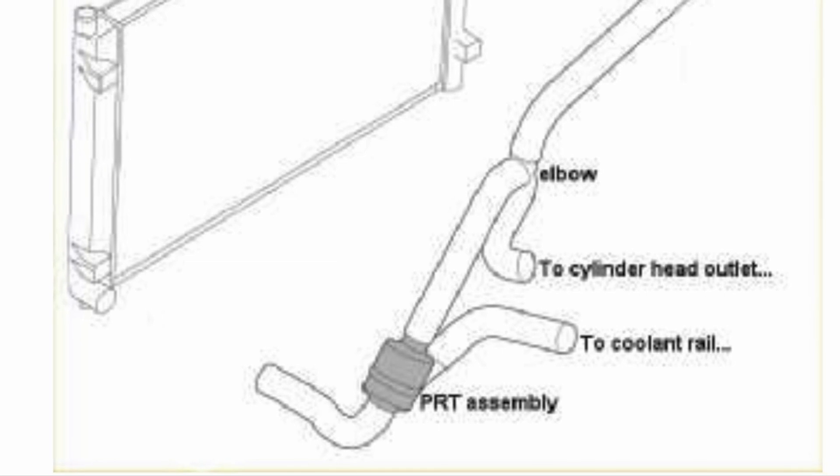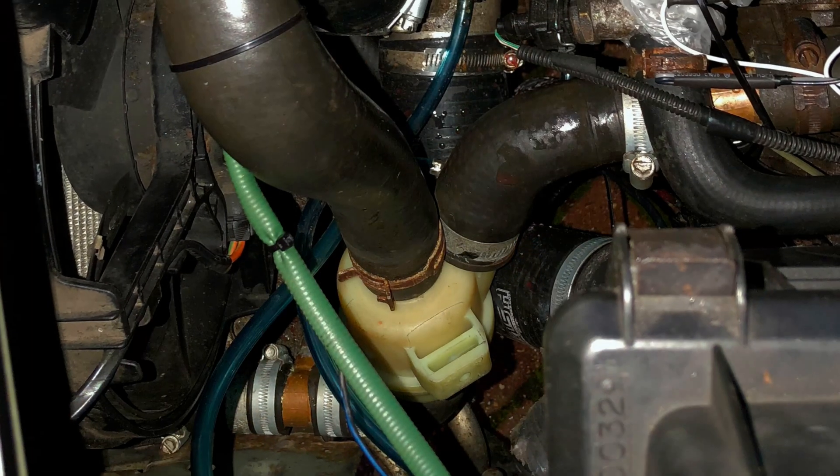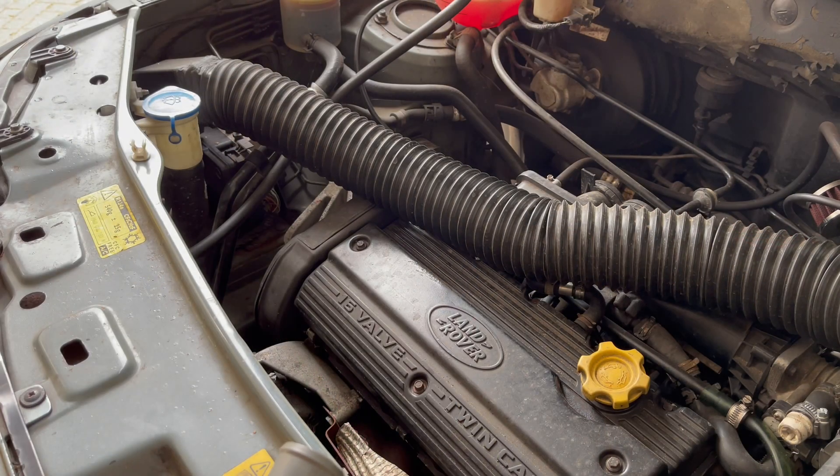Looking at a diagram of a typical PRT setup you can see how it's plumbed in. This overheating is something you might never really notice — for me it only very occasionally happened, once when the car was sat in a testing station idling and it overheated and started boiling over even though the fans were going like mad. The second time was in traffic. If you blip the throttle this problem goes away for about 10 minutes, but if the car sits idling for about 10 minutes it can overheat.